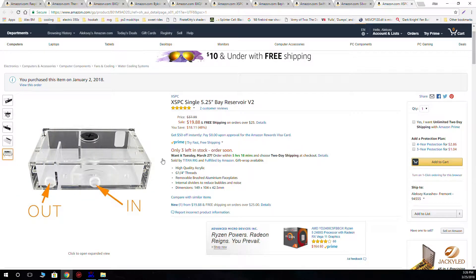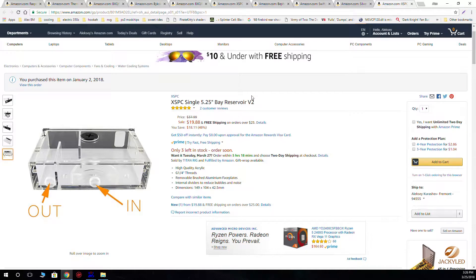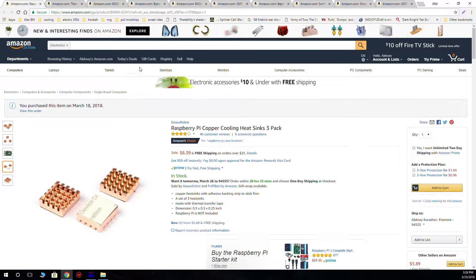This specific reservoir is nice because it actually has some baffles inside, so it's really quiet when it operates. That means you don't necessarily have to have a very loud water cooling system in your case. It just fits in a DVD bay drive, so you don't have to mount anything inside of your case. And if you happen to have one of those cases where you have DVD bay drives with some fans in front of them, you have the potential to get even additional cooling inside the reservoir in addition to from the radiator itself.